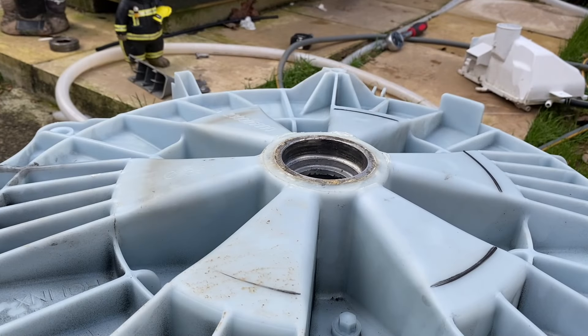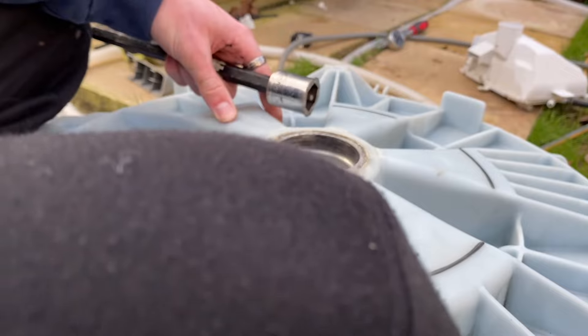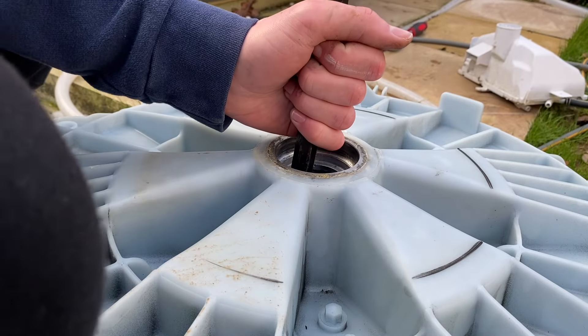What I've just done is removed the bearing seal to make my life hopefully a bit easier. If you can remove the bearing seal then give it a shot, but if you can't remove it then you're just going to have to try and hammer it out with the bearing still in. I'm getting there with it, working my way back and forth - it's a lot more work than the back one though.